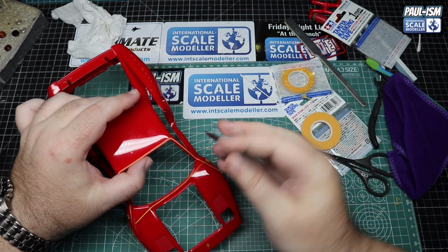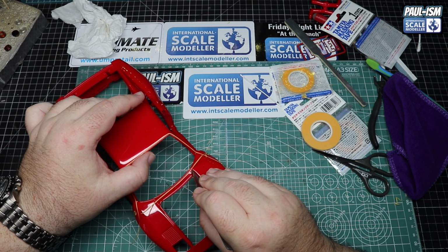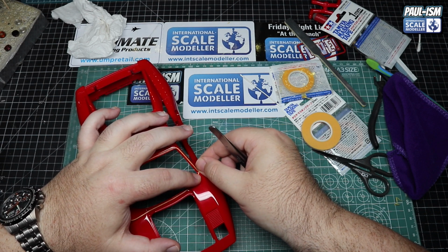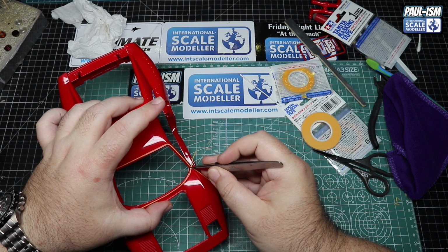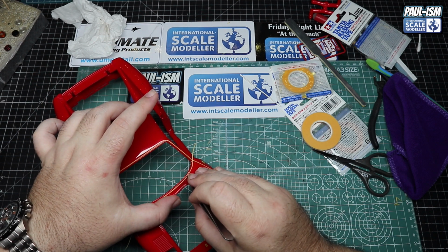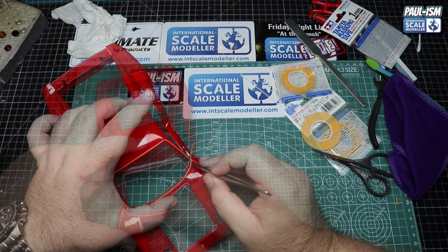And then along the bottom, a little bit fiddly, you've got this little indentation where the luggage compartment cover goes. And again, just follow the profile of the window around. And just gently burnish it down. Once you're happy, you can repeat that on the side, like we're about to do, and then we can infill it with larger tape and then cling film.